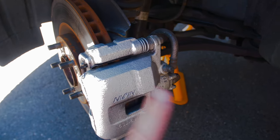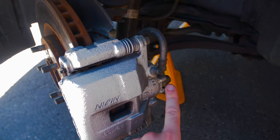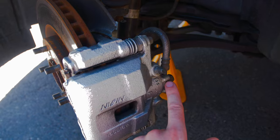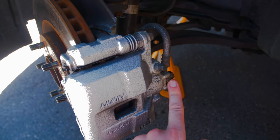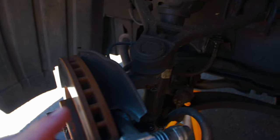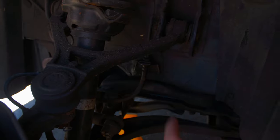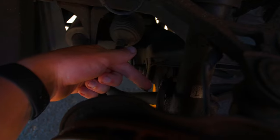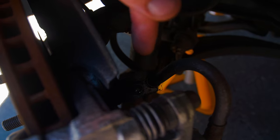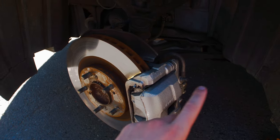The wheel is off. At the back of the brakes we've loosened this bolt and then tightened it back up slightly, so once we take this apart it'll be easier to remove rather than trying to undo it for the first time off the car. We've also sprayed some WD-40 in several areas - up here, here, and down here - those are the bolts you need to get the line out if you're doing the braided line upgrade.